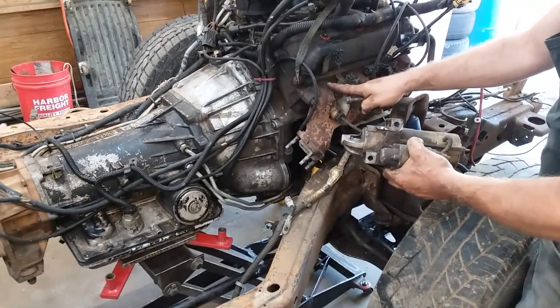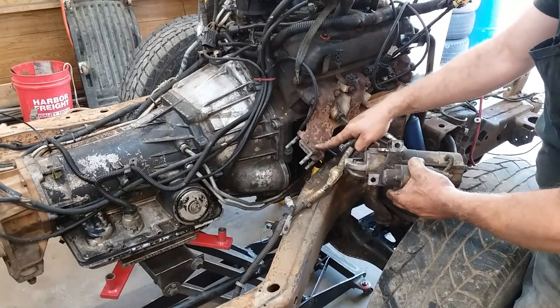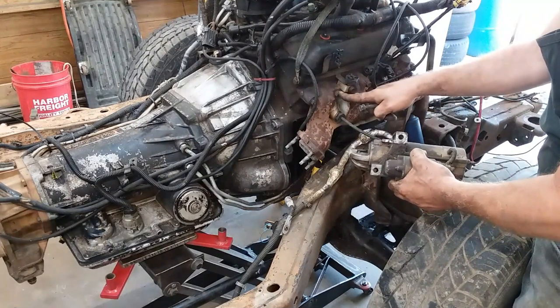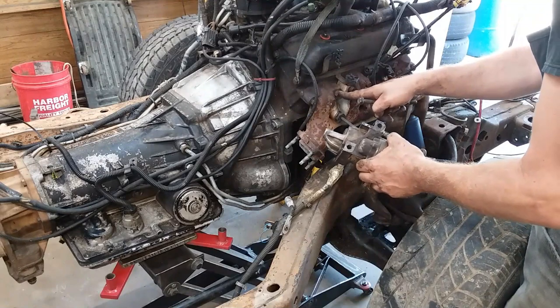On these Chevrolets of these model years — this is a 2000 model — but this engine being derived from a 350 has SAE fasteners on it. This is a 3/8 bolt. You can see a grade 8 stamp on there, maybe even a grade 10, but that is an SAE fastener. So pretty much everything that goes into this block will be SAE. Now these over here are metric, but these block bolts are going to be SAE. It is greatly confusing, but that's just the way that it is.